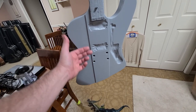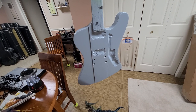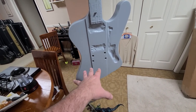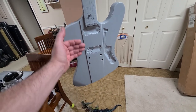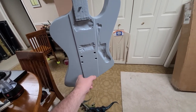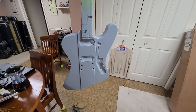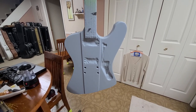It kind of looks like it's feathered in. And the sprayable primer, the thicker stuff, fills that. So when I do my sanding on this thing, again block sanding, this is going to be all flat, so you shouldn't see any waves or nothing. The only thing you should see is just this lip on each side where that's supposed to be. So that's the nice thing about using a sprayable primer that is a filler primer.